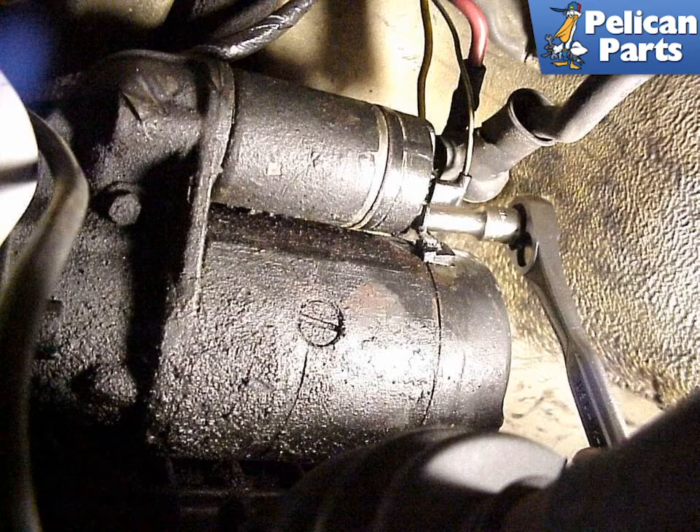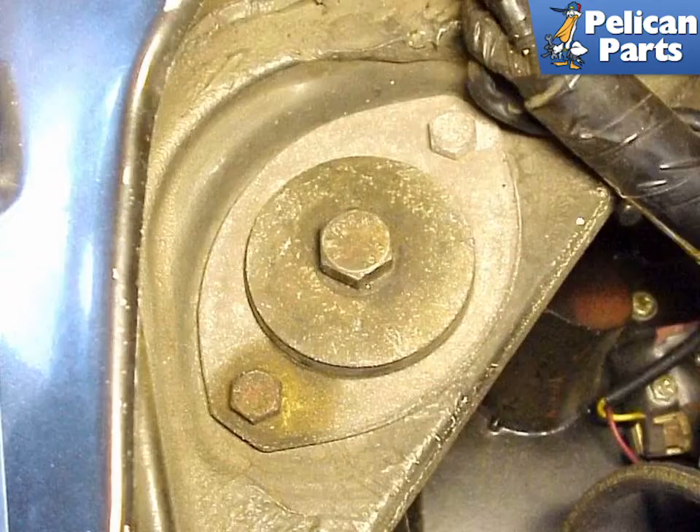The fourth nut that keeps the transmission and engine together is also the one nut that holds on the starter. The nut is a 10mm barrel nut and requires a 10mm hex key or socket to remove it. This nut is not visible from any angle, so removal is especially difficult and must be done by feel. The lower barrel nut that holds the starter is similar and does not have to be removed in order to remove the engine. Again, it is recommended to skip these steps and drop the engine and transmission together — it is much easier than trying to access those nuts while in the car.